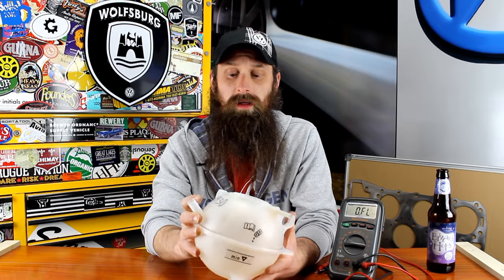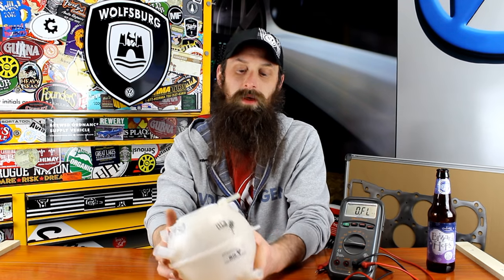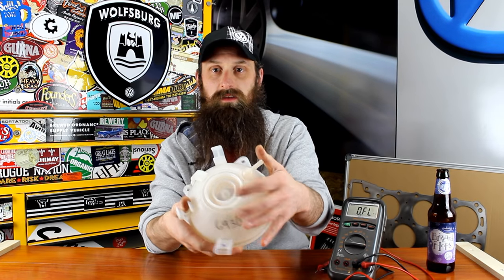So how do we know our coolant bottle's failed? If it's leaking, we're going to notice the coolant level drop. You'll also see — usually around the return — a pink crust, which is a sign of a coolant leak. So if the level's low and there's a crusty spot around the connector or anywhere around the seam, we know we've got a bad coolant bottle. We also might get a coolant light in the instrument cluster when the car's cold and the coolant level is full. This was really common in the Beetles because they didn't have a temperature gauge — you'd start the car, the red light would start flashing, but you'd open the hood and the coolant level would be at the proper spot. That means you've got an issue with the contacts in the bottle or the connection.